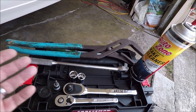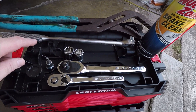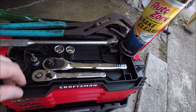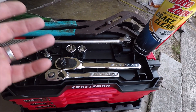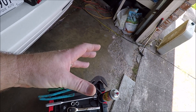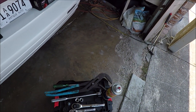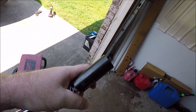For the front you're going to need the parts, some brake cleaner, a breaker bar — I have a short one and a long one — a screwdriver, an 18 and a 19 millimeter socket, and a T30 Torx bit. You're also going to need a jack and jack stand. The channel locks are for compressing the pistons in the calipers. You can also use a screwdriver wedged between the old brake pad and caliper for leverage. They do make a proper tool for this. And to get your wheels off you'll need a 7/8 socket.